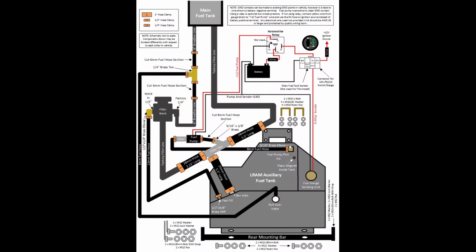For the stage of test fitting the tank, what we're going to want to connect is just the red hose that connects to the large T, and that's it. So those will be the only pieces we'll be throwing on the tank for this test fit. And again, for those large hoses, you only want the red one, and that's the one between the tank and the T. And then that way we can see exactly where that T goes on the factory fill lines for cutting. And that's the entire point of this test fitting.